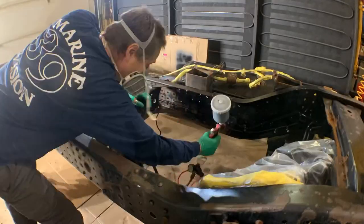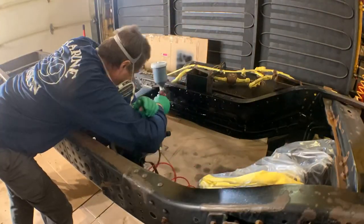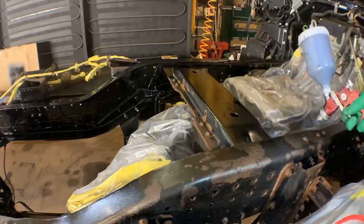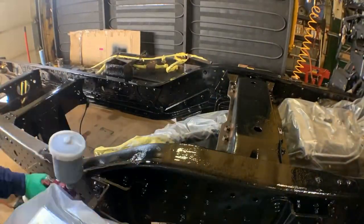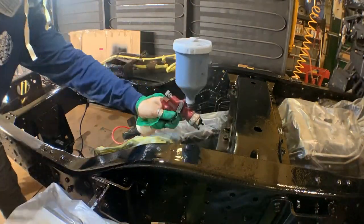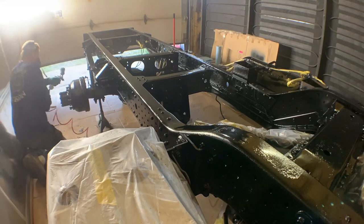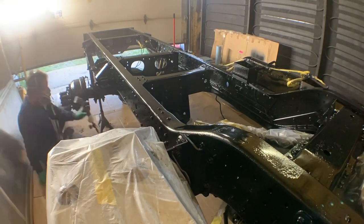As you can see, there isn't much overspray — actually, there isn't much spray at all. As it turned out after a long struggle, I found out that the paint gun was not working properly and I just couldn't get a very big spray pattern. The longer I painted, the smaller the pattern got, and no matter what I adjusted, it didn't get any better. Eventually I switched to my touch-up gun with the much smaller hopper, and what a difference — I was painting 10 times faster, though it was cranked up significantly and there was more overspray.